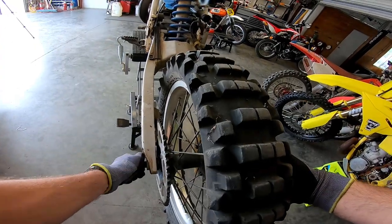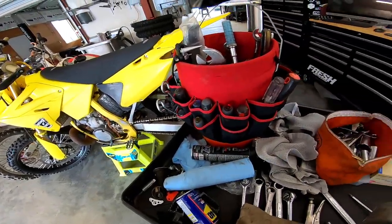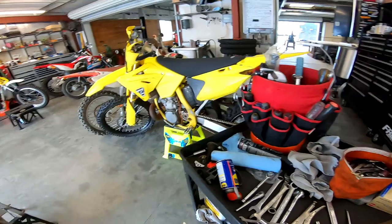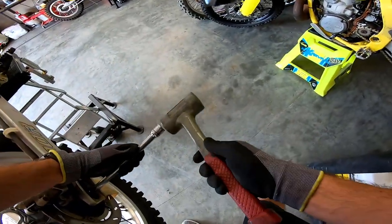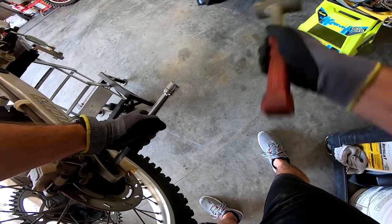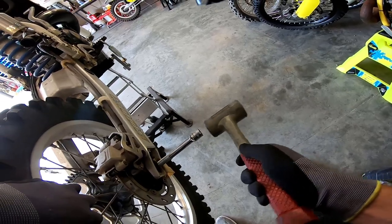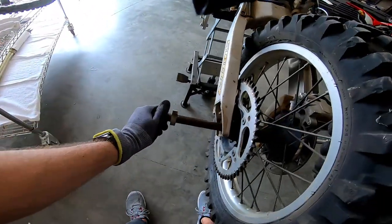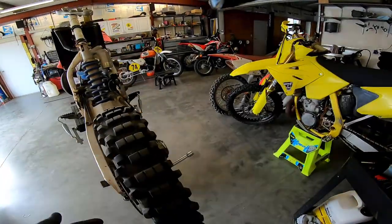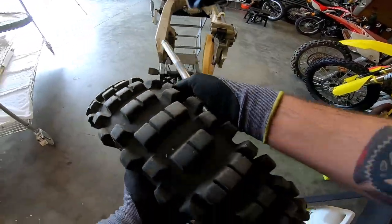Back to that rear wheel. I don't think I'm going to have a whole lot of luck spinning that out by hand. Desperate times call for desperate measures — go ahead and get anything that works like an axle, say a half-inch drive extension. So long as you are not marring it, you can use it as a dowel. Keep firm contact so it doesn't slip off. This will also hold the wheel in the air while you're pulling the axle out — it's got a ton of grease on it, it's not in bad shape. On the rack. The wheel comes off — now you can remove the forks without the bike doing a complete backflip on you.